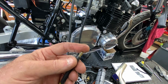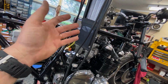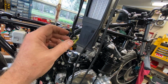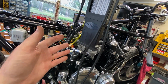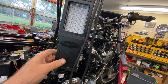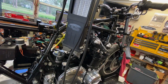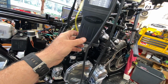Turn down the OD, part them off and make 4 of them, then put these in line and see if we can get a better reading, because I've never experienced that before. When you rev it up and it banks down, the vacuum comes up just fine. I think that's because the impulses are closer together at a higher RPM. But when you ramp it up, it doesn't do that because you have the throttle open, so that would be a lower vacuum scenario. With the RPM up and you drop the throttle down, it picks up and it's in the right spot. Again, I think this is too small, so I'm going to make them a little bit bigger and see what happens.